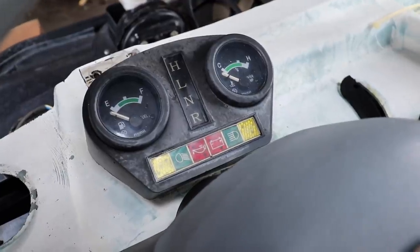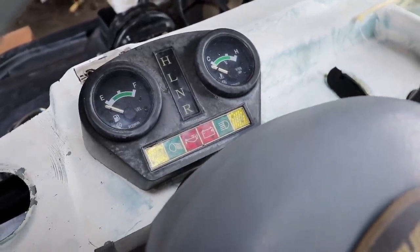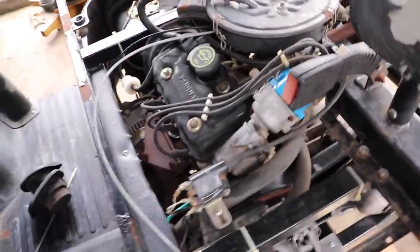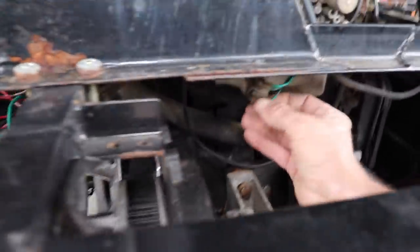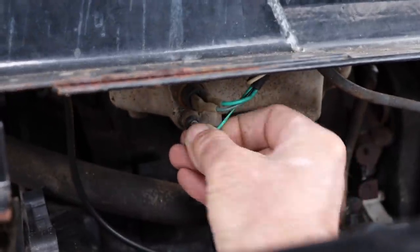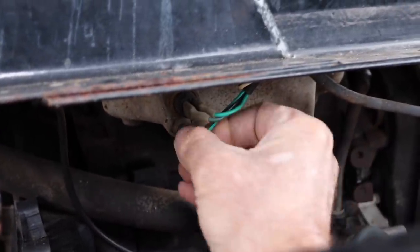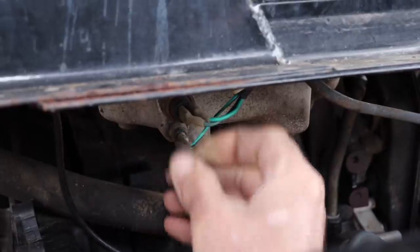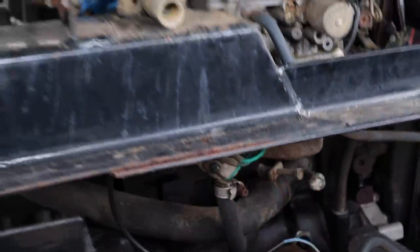Elkskins found a wire that was off on the back of the manifold — a little tiny green wire. This connector is kind of crappy, and I'm going to clean up these connections. But that wire was off, and now the temperature gauge works. I need to fix that connector. I also had to tighten the belt — remember in one video the belt was squealing.